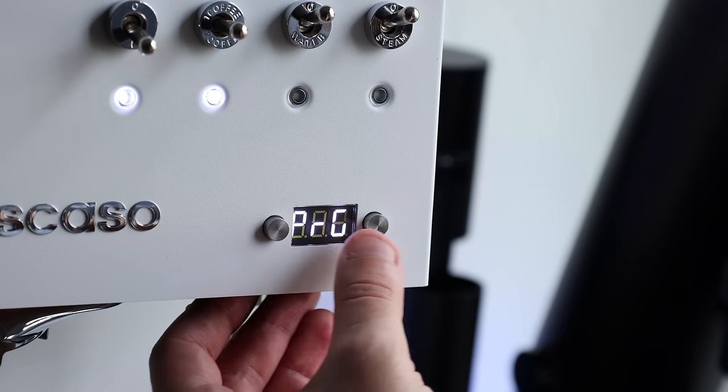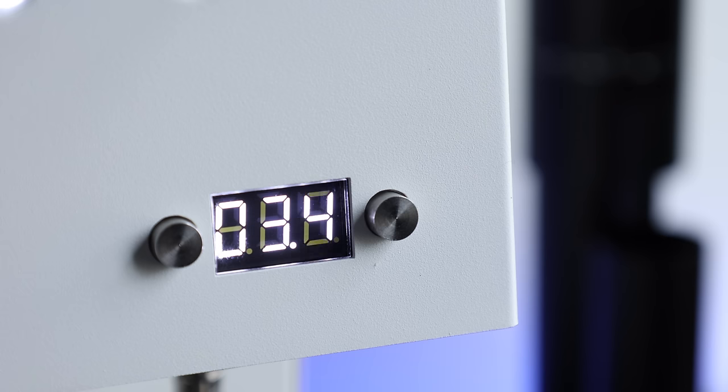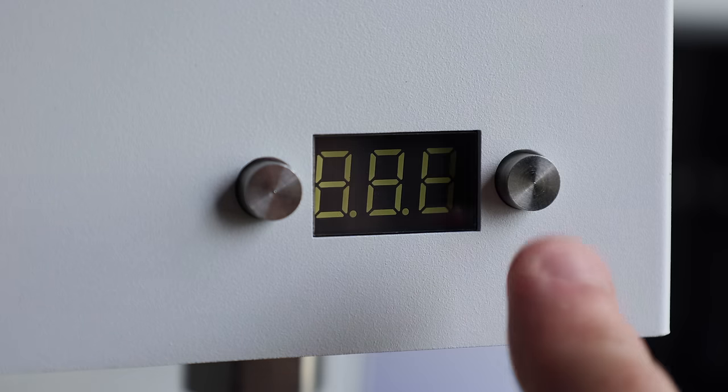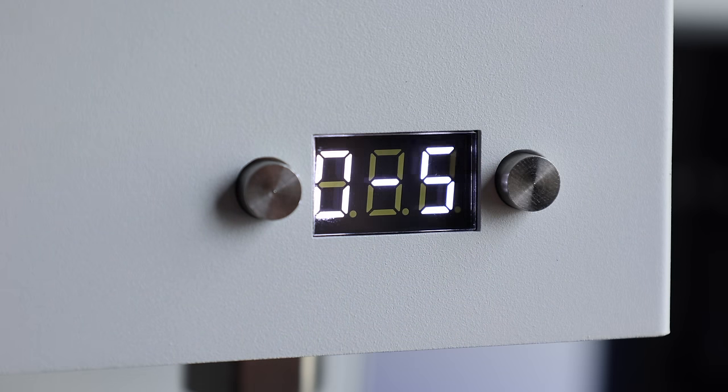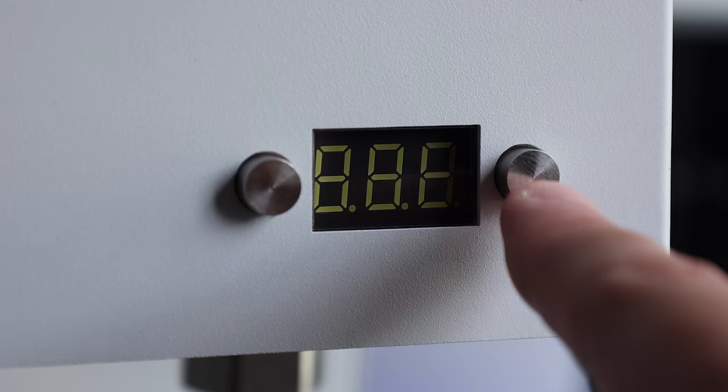On its face, the digital PID is clear and easily adjustable, and can be set up to double as a timer during shots as well. Also, through that front main screen, you can toggle Celsius or Fahrenheit, standby modes, and coffee counters. But when it comes to actually brewing, you can also adjust pre-infusion, which gives you options from both starting at switch on up to 5 seconds, or having a short burst of pressure followed by a short pause.